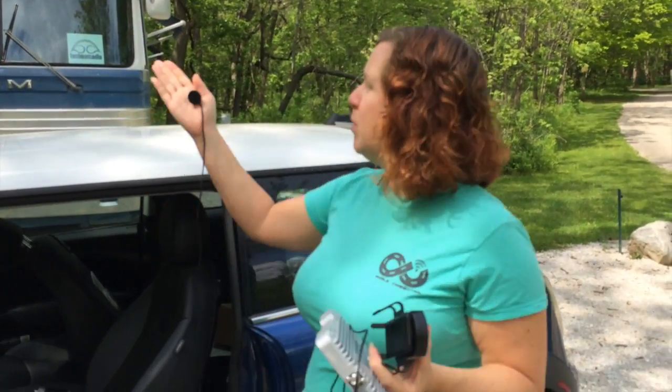Not bad on a car — most cars have a metal roof so that's not a problem. When we get to an RV however, not all RVs have a metal roof. In fact most of them don't. If you have a bus like we do, or an Airstream, or an Avion, or any other metal-constructed RV, you're good. You'll be able to put this antenna on the top of your RV's roof and get that signal amplification from the reflection of what we call the grounding plane. If you don't have a grounding plane on the RV, you're not going to get the full signal strength.